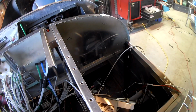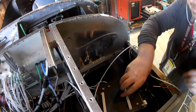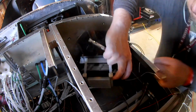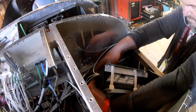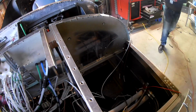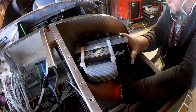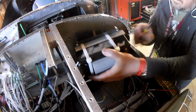So that piece of carbon fiber that's mounted on, I've also got the main bus and the avionics relay mounted to it. I can take that whole thing off with 4 screws from the front. When the 4 screws come out, it just hangs down because I've got the wire bundled in the right place so that it can fall loose. That way I can work on it, and that's what you want. You want to be able to get to anything and work on it without having to lay on your back with your head jammed up under the panel in massive amounts of pain. Let's just avoid that if we can.